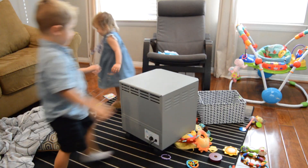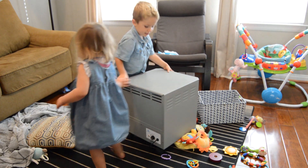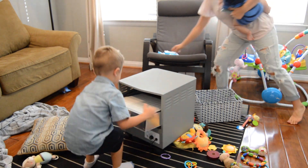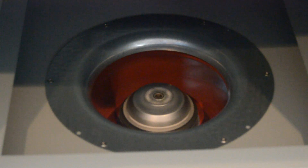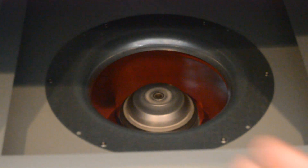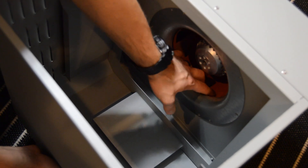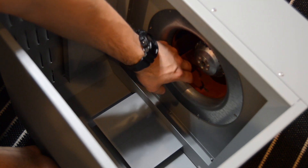Those two things were mostly aesthetic. The one thing I really didn't like had to do with safety — I'll preface this with saying that I have three small children. It didn't take much time for my four-year-old to figure out how to take the filter door off and remove the air filters, which exposed the squirrel cage fan underneath. There's no interlock on the unit to prevent starting the fan with it exposed, and once the fan is running, it's easy to stick your hand in or put toys in there. After realizing this, we stopped running the filter when the kids were upstairs unsupervised. If you have small children, you're going to want to do the same. As a former vacuum cleaner engineer, there were rigorous safety tests done on our products to prevent this. I would recommend EnviroClean rivet on a metal screen over the intake to the squirrel cage with holes small enough to prevent little hands or small objects from being put into the fan.